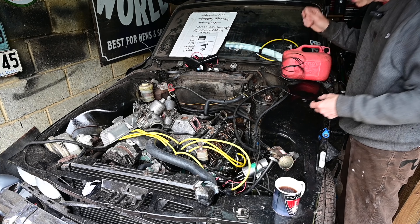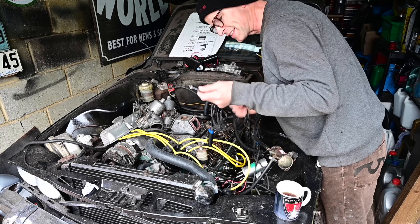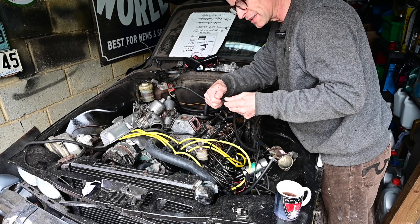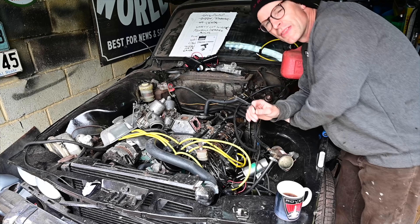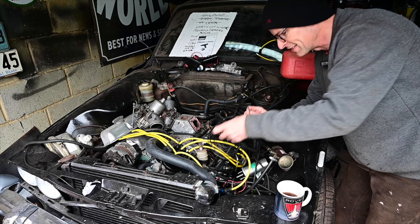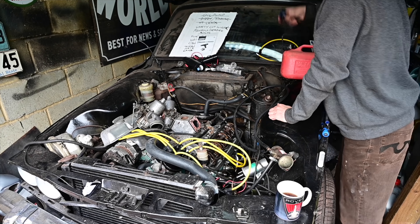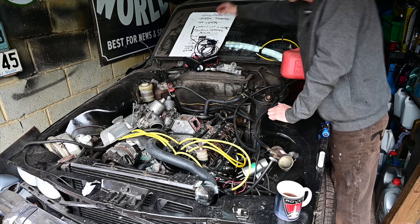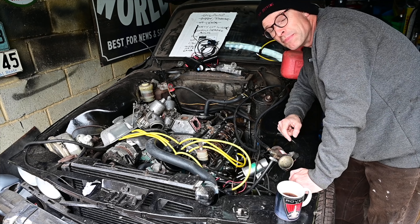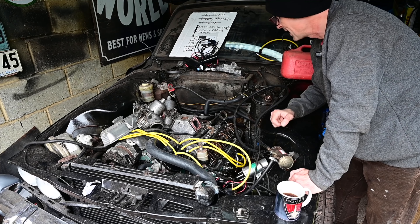So we put the compression tester to one side and fetched the next tool - the WiFi endoscope. We've got all the proby tools on this channel, with the big extendy alien probe thing last week, and now we've got the camera on a stick with a little screw-on mirror so you can look periscope-style up inside things. Guess what it found: the valves aren't shutting completely - a little tiny gap between the valve and the cylinder head, meaning no compression. You guys were right!